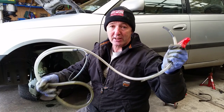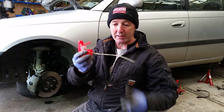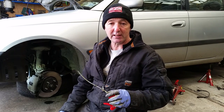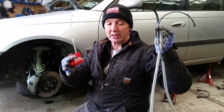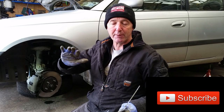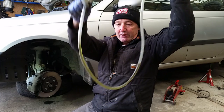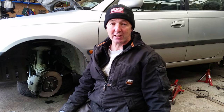And it didn't cost anything. It's just a squirty thing out of cleaning products — Flash or whatever. One of these and a bit of clear plastic tubing. Just make sure you can fatten that out and get it onto your tube. I just rooted around and found a few bits of plastic, connected them up, cost nothing, and boom — onto the car. A couple of seconds later it's purged. You're out there vacuuming your brake fluid down the line. Normally when you're in the car pumping, that's positive pressure driving it out — this actually sucks it from the reservoir all the way down the line and into a little container underneath. You can see the brake fluid in the tube. Simple little life hack for free, saving a lot of time, and you don't even need anybody in the car — you can do it on your own.